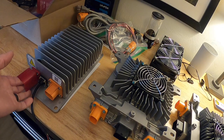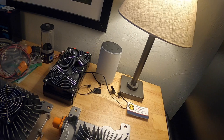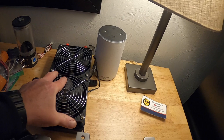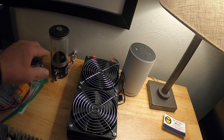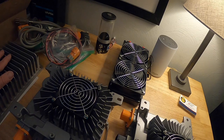Back here I have my cooling unit. As I showed in the previous video, my motor controller inverter has water cooling on it, so this is going to be the radiator. The fan will just come on with the key and run constant, the water will circulate through this pump, holding some radiator fluid glycol in there, then circulate it through the motor controller chiller plate and back through the radiator to complete the circuit.